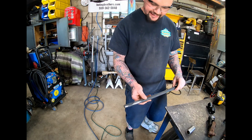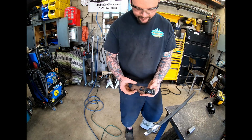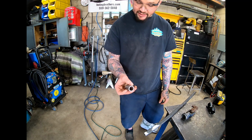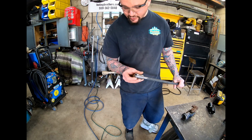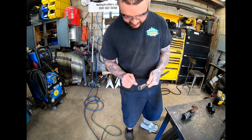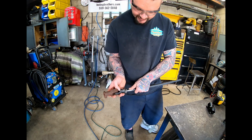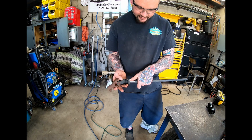And to connect to the pinion, I have this factory piece from the truck. So I cut it right there and I drilled 2 holes. And the plan is I have some of this, just a piece of scrap that I cleaned up and cut to length. I'm gonna drop it on here, and it's not an exact fit, but it's pretty close. So I'm gonna get it centered up to the best of my ability, and I'm gonna end up welding up this end and then welding it on this side. Once that's welded up, I'm gonna drop it down in here, which it fits pretty tight, and it will end up getting welded around the top and through those couple of plug welds. So all this will end up becoming one piece.